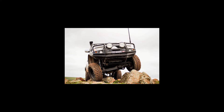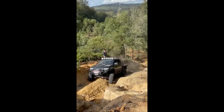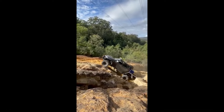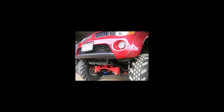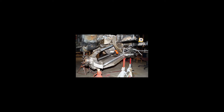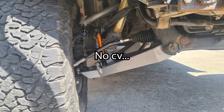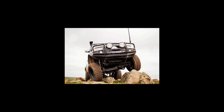It's not only flex — it's also the strength of the solid axle that makes it great off-road. For example, IFS will break its CVs constantly with large tyres and a front locker, while solid axle will be fine. That's not to say solid axle doesn't break CVs, but it's a lot harder. I've also learned that there is actually less clearance at the diff on a solid axle than on an IFS. I did some research to see whether a good IFS setup exists — there are racing setups, but they're apparently hard to get approved in Australia. I still want to stick with IFS, though solid axle always seems to show us the ultimate.